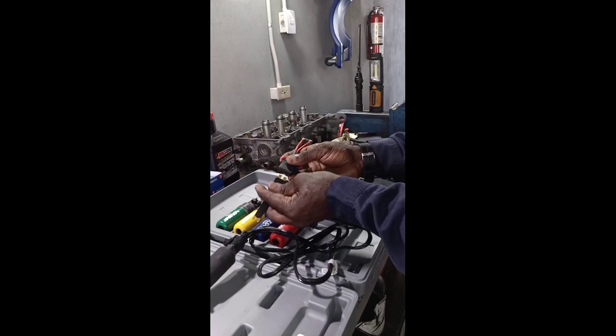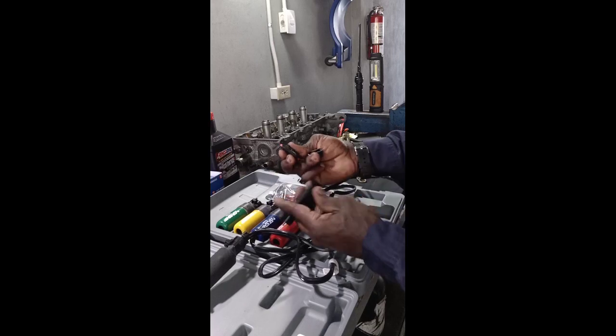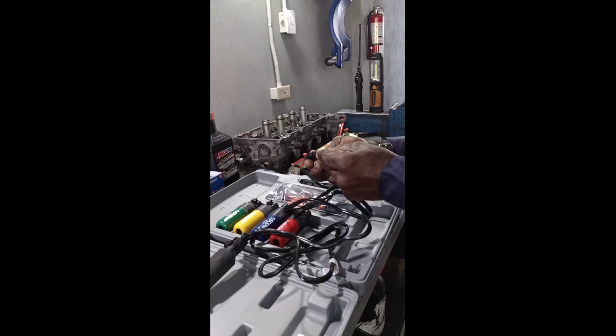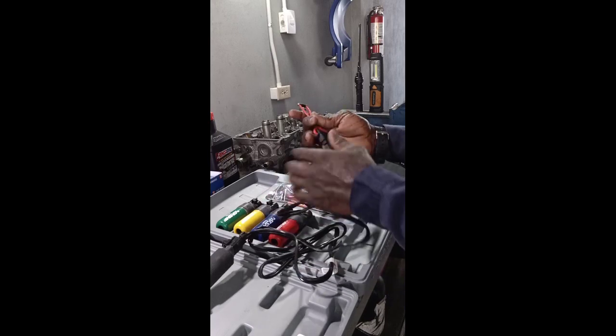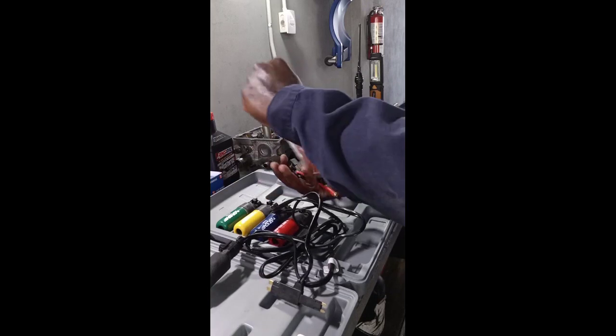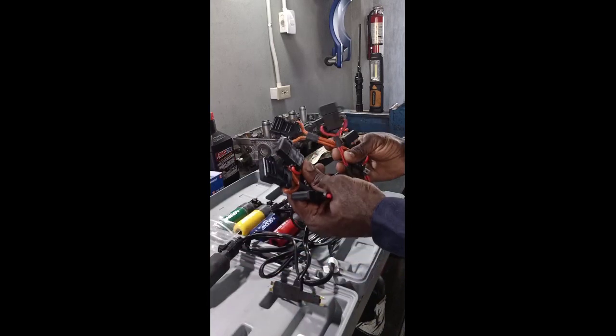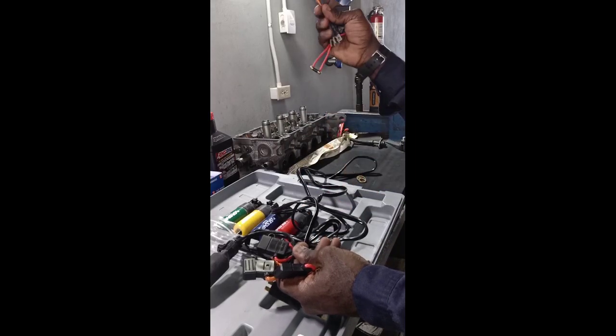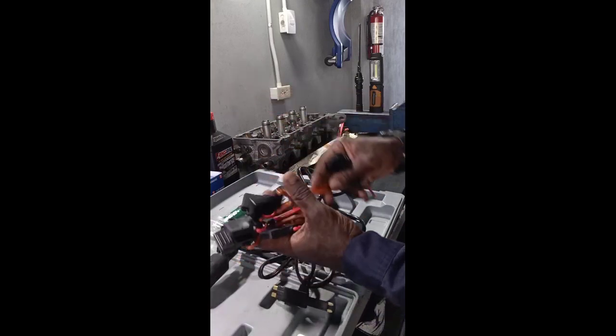This is the mini and maxi fuse adapter. You can use the fuse body and incorporate it that way — you just pop this out like this, it fits like this, then you slip this into the fuse socket. This is for older style vehicles. The other fuse bodies I normally use when checking fuel pump amperage and coil pack and things like that.